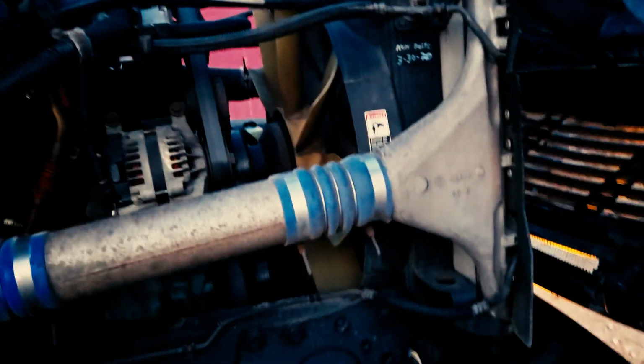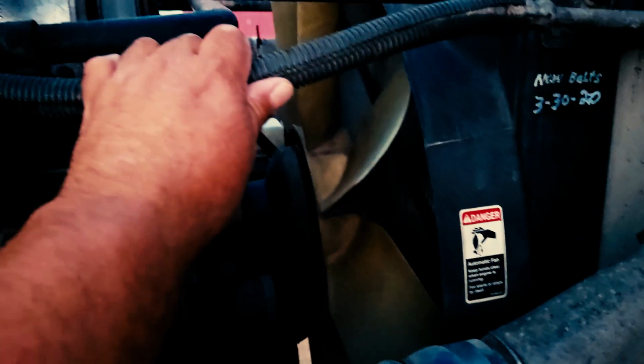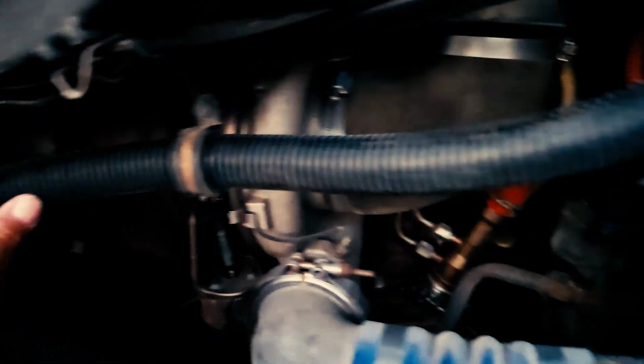You're going to tell the examiner, I'm going to inspect, starting with my air brake line, every visible hose that I can see and touch at both ends to ensure that they're properly mounted and secured, and there's no abrasions, bulges, nor cuts, and no leaks of any kind. I'm also going to inspect all my electrical wires, starting out with my ABS line to ensure that they're properly mounted and secure at both ends. Every electrical wire that I can see and touch, I'm going to inspect to make sure that there are no cuts, tears, or frays.